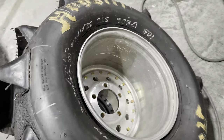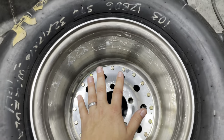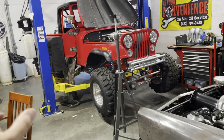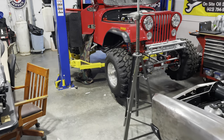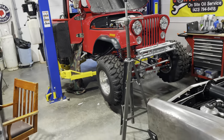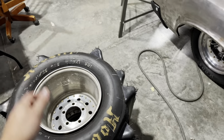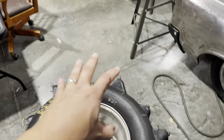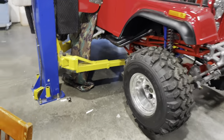What we didn't realize was that the existing set of rims and tires would become obsolete because the dimensions didn't work with the offset. The wheel offset — you can see how deep this wheel is — was made specifically for those wider axles to scoop the rims and tires in toward the inner fender. Because of shortening the axle tubes, that killed everything. He'll need a different offset rim. I think they make a shim insert for these three-piece rims to get the spacing right.